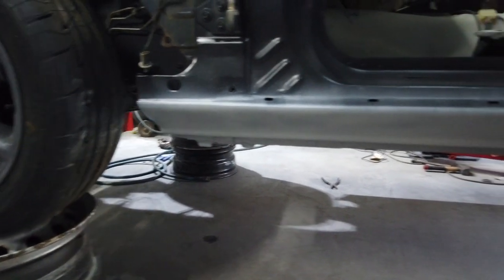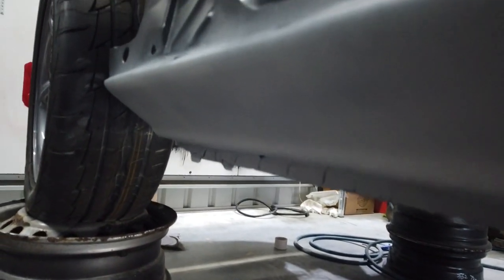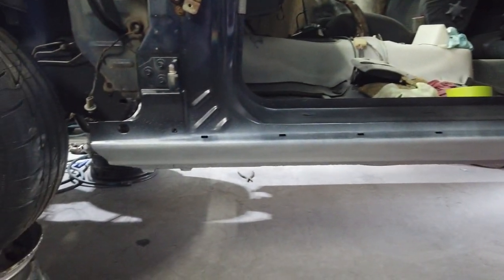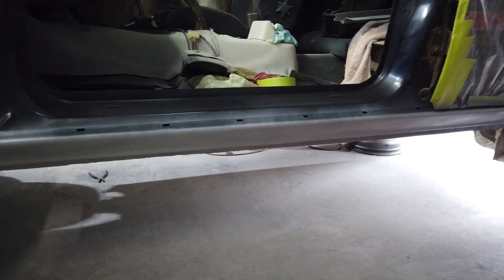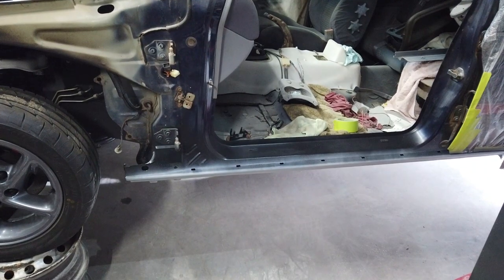A couple of days later — work's pretty slow on this thing. I satin blacked all the sills but came back the next morning and wasn't happy with it. So I sanded it again, got into the bog again, and made it a hell of a lot cleaner. It's still not 100% but much better. I've painted the sills satin black again and now I've gone back and applied a stone guard — a textured finish similar to underbody coating — which should hide a few of the imperfections. Once that dries I'll hit it with another coat of satin black on each side and the sill panels are done.